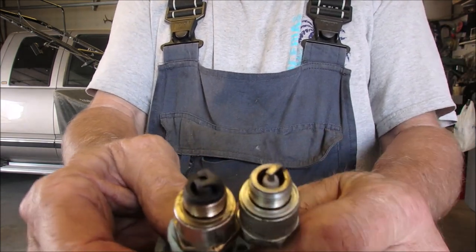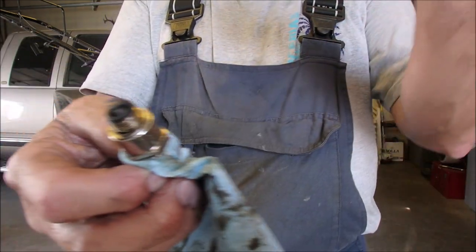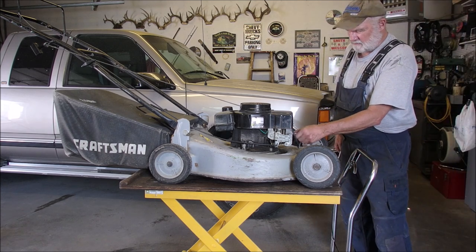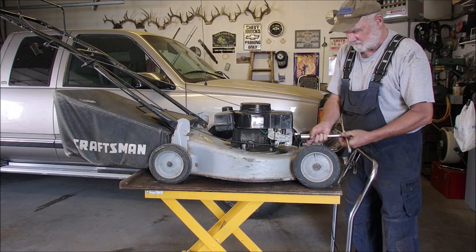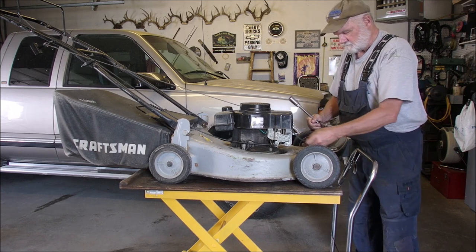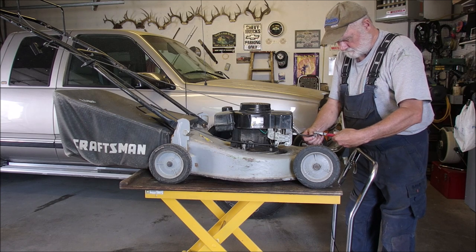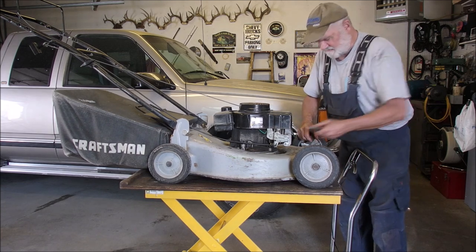Okay, so there's a nice J19 and the E3, you see, goes a little deeper, right? And that's got about a 30 thousandths gap. I'm just going to throw this spark plug in. What I call a go-to-hell move, you know? What the hell? We'll try a J19LM spark plug. And we're going to tighten up. There, that's not going to fall off.